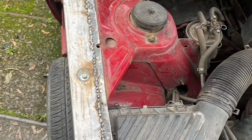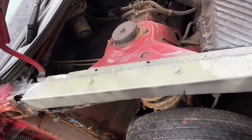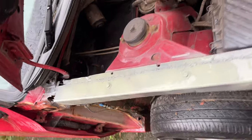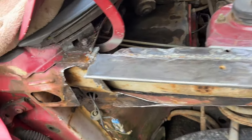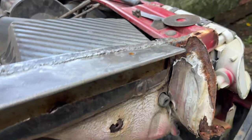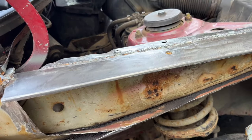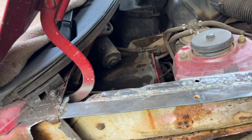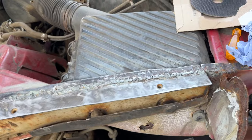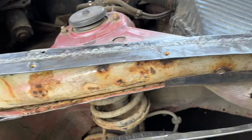And there it is, all welded in. Just going to fill the bottom - wing fits, jobs are good. Bit of backtracking on the inner wing: I'll cut the side of it, the metal is too thick so it's hard to bend. There's the cut there - that's what I'll do, just box it all in. Obviously paint underneath and treat it all first. Cut it down - a lot better. Clean up inside, paint them up, box it in, job done.